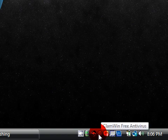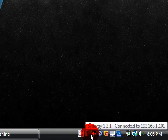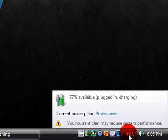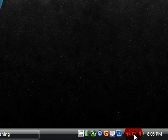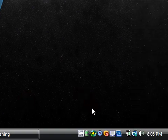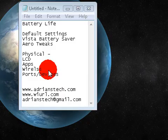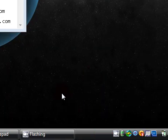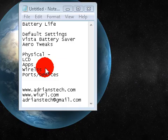Your essentials will be like your antivirus software - you can keep that running, obviously, and main stuff like your touchpad driver. Other than that, you may not even need some stuff - maybe you don't even need wireless. If you're on a hardline connection with no charger, or if you're on wireless you can keep that on. If you're not on wireless, turn that off because that will save a reasonable amount of battery. There's even a little switch for wireless you can turn off. Turn off all your background apps running in your tray - stuff you really don't need. Each bit helps.